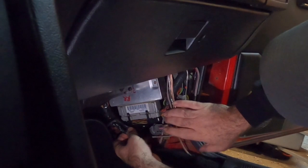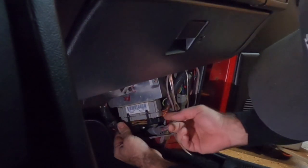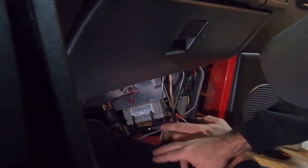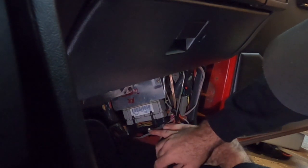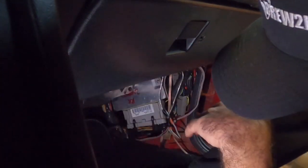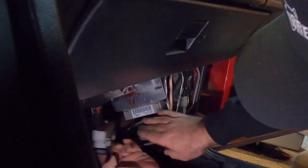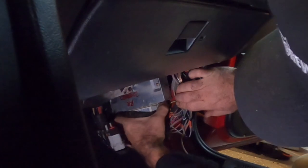Now the way I like to get these computers out, because they can be a little tricky, is pull it out towards you like this, to where you can go ahead and access this 10 millimeter. We're going to put a socket on this thing, take this bolt out, and this will allow the connection to come off of the computer. All right. Connection should come off. Just move it out of the way and you should be able to wiggle this computer out